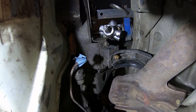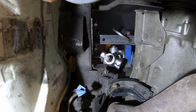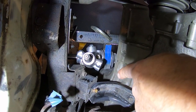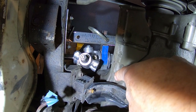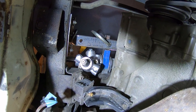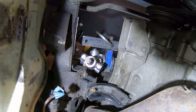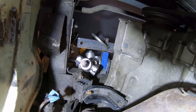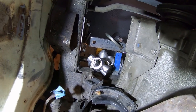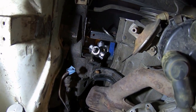And then the steering rack is right here. It's actually a lot closer forward than I thought. Here's that thing I cut off to hit the oil pan. It probably would have hit the oil pan because it was a big, ugly bolt stick. So I've raised it up a lot and moved it over. And most importantly, I've got the rack precisely lefty-righty centered. I know exactly how much is going to go out. So I'm going to weld it in, or at least tack it in, and then we'll do another bump test.